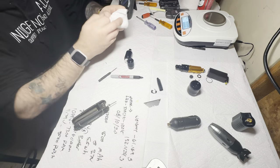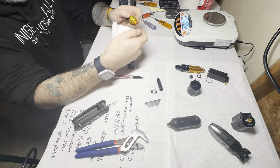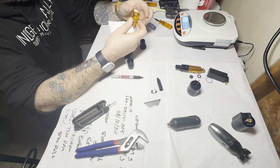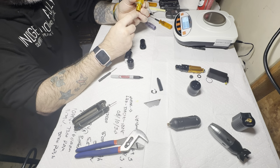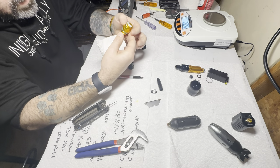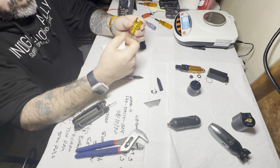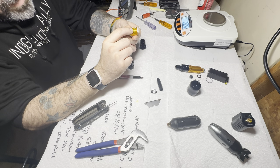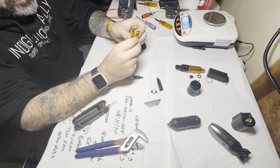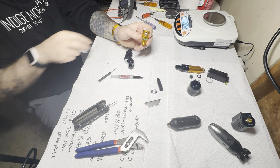Final bit here on the tests. Let's go ahead and pull this front chuck off — grab a pair of channel locks to do this. Use a piece of paper towel or cloth and it won't mark it too much. Pulling this slide off, go ahead and take a peek inside. Same standard thing as before — this is a better quality than the previous machine tested. We have our slide spring and a little bit of grease. Fun thing is that normally when they do these applications they'll put the grease in last, so there actually isn't a whole lot along the slide — this one's basically bone dry.